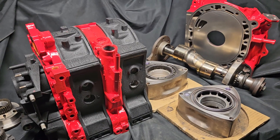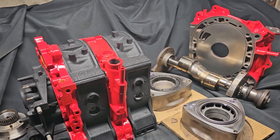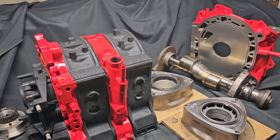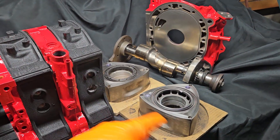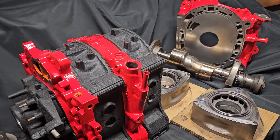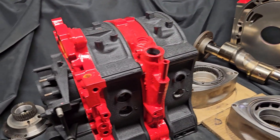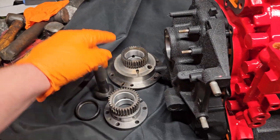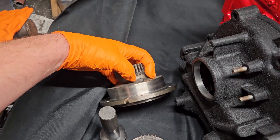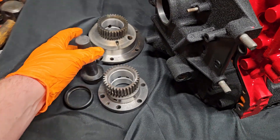The motor's capable of anything from as low as you want to go — 300, 400 — well up into the almost 700 horsepower range. With the oversized studs, balancing, and side clearancing, you've got a really nice package that can be reliable, run to 9,500 RPM, and sound great — it's got the brap. Stationary gears, we're still putting them together. I just pressed in the new bearings, and one of them the set screw actually got damaged. Mazda Tricks has those on the shelf — classic factory press tools.